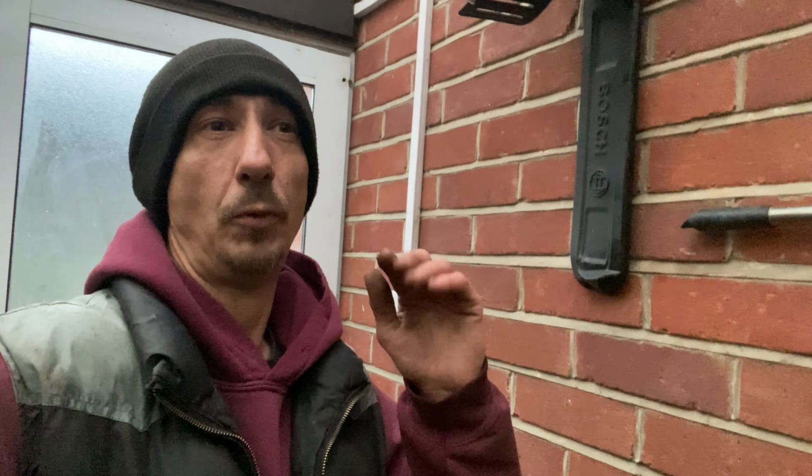It's getting dark, it's starting to rain. Need to get the van keys. We'll go for a test drive, test the brakes. If it locks up when I apply the brakes quite hard, if it locks up on the rear, then I need to adjust that bias valve. Shouldn't be a problem, but if it does need addressing, we'll do that in a separate video on adjusting that.